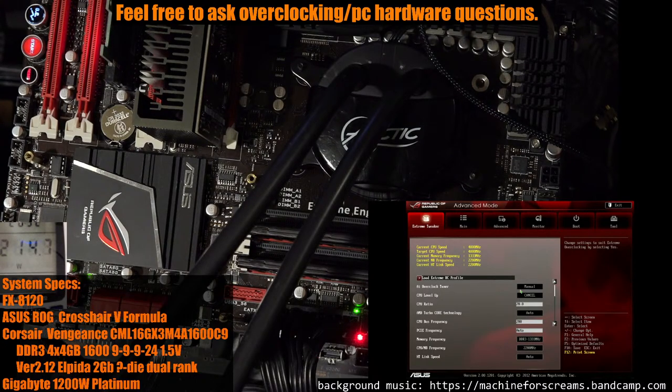That's the really annoying thing with offset. Actually, the Super IO should measure that. It's not going to be an accurate measurement, but you'll be able to tell from the Super IO if the voltage is high enough or not. But yeah, that was the thing: I thought it looks like it should go over 2 volts, and then I tested it, and no, it doesn't. But if you're on dry ice, that's not a concern. That's really not a concern on dry ice. There's no way it would scale that high on dry ice.